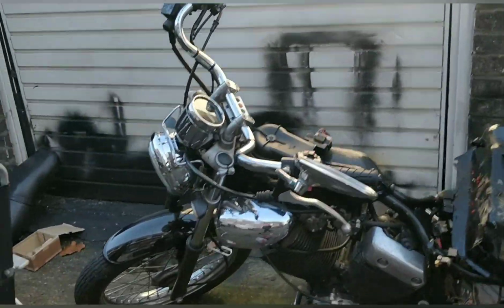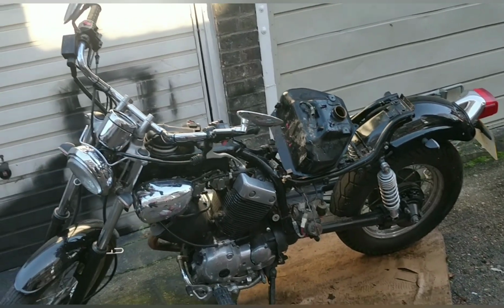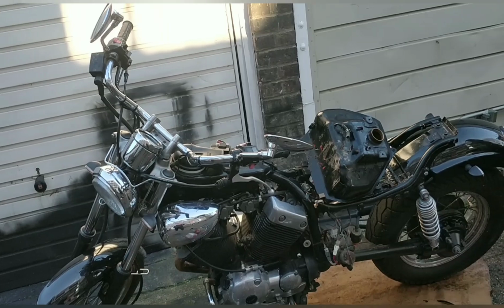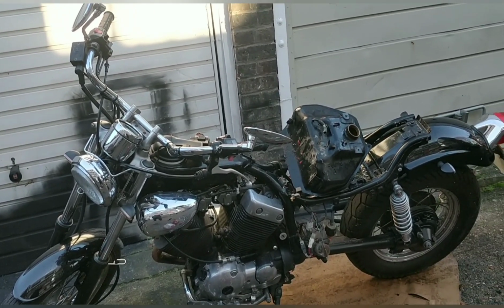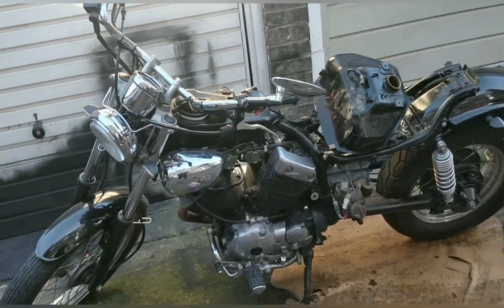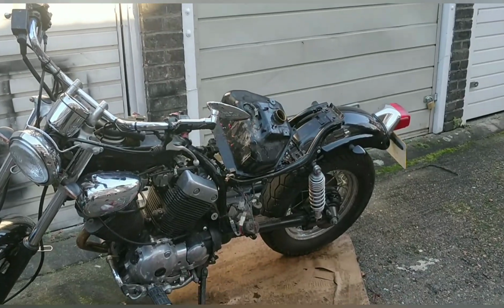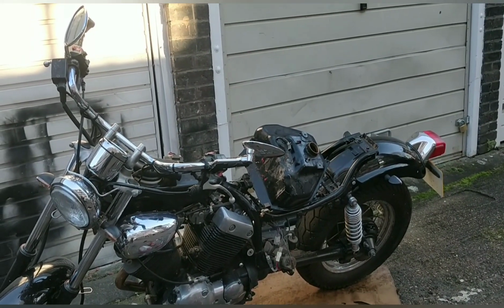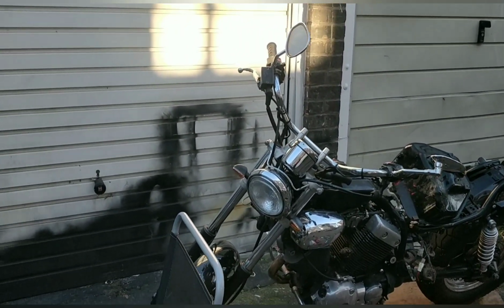The advice online and the advice over the years that I've heard is not to use sealants in your tanks. I know there's people that will disagree. I know there's people, mechanics, guys, people love a good argument. But my advice is not to use the sealants. They can cause more issues than they're worth. Clear your tank out properly like this. Put fuel in it immediately or as quick as you can. Put a nice new fuel filter on, you'll be fine. Change your fuel filters yearly.